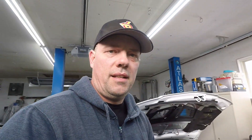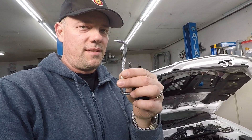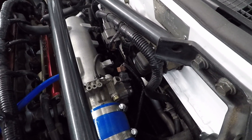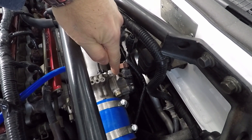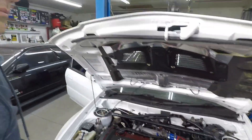You'll need a couple of tools: a screwdriver that can get in behind the throttle position sensor, and a shorty screwdriver for the base idle set screw, which is basically a bleeder screw. The two spots we're focusing on on the throttle body are the throttle position sensor over here, and the base idle set screw right here.